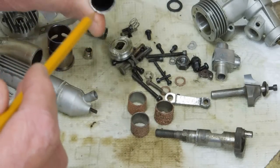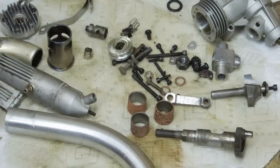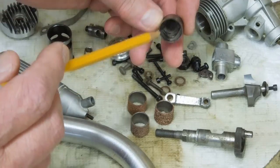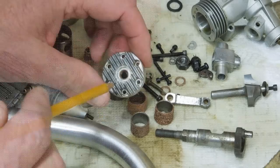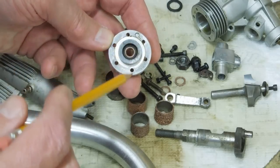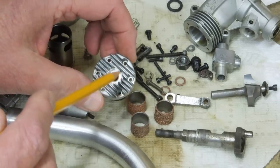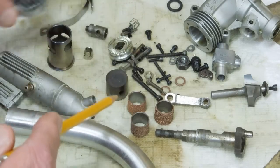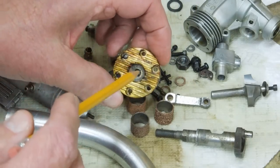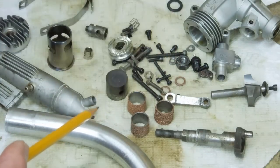The carbon is still inside here, but it's very loose — it's not greasy, it's a powdery type thing. A little soap and water and put that in an ultrasonic cleaner will knock that out of there. The piston still has some carbon sitting on it, but it's loose — the piston is clean, I just need to scrub that with a toothbrush. When you start cleaning things like the head, all this material is pretty much out of these fins. Most of what you see here is from all that heavy residue floating around inside the glycol — these fins are clean. When you go to scrub these with a toothbrush, don't use a wire brush, especially on the HP-40 head, because you don't want to scratch the anodizing and spoil the appearance of the engine.